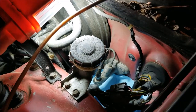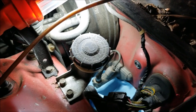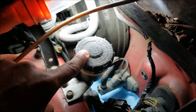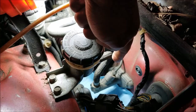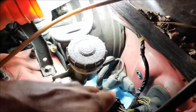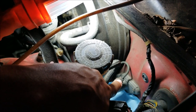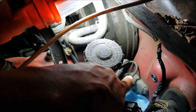Here's just a quick overview of the clutch master cylinder and the components associated with it. You have these two 10 millimeter bolts, the clutch fluid reservoir, the clutch line going back to the master cylinder itself, and then the clutch line that goes to your slave cylinder on your transmission in this piece right here.